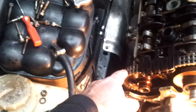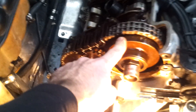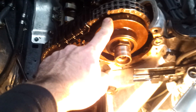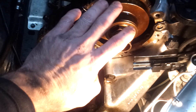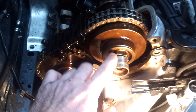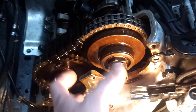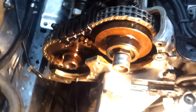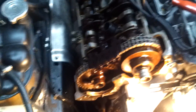Timing — this one had jumped a lot, so I had to put it back in the right position. The adjustment mechanism is a pain because there's a piston in the middle that has to be put in first, and then it's spring-loaded so it keeps coming out. When you put the cam gear on over that piston — there are teeth in there — and then on top of that you have to put the chain on it. Everything is sort of awkward to work with, but it's doable. I did it myself; one person is enough, no need for two.